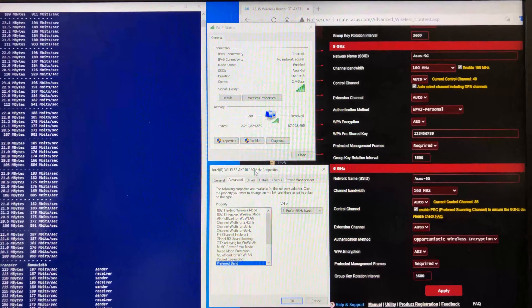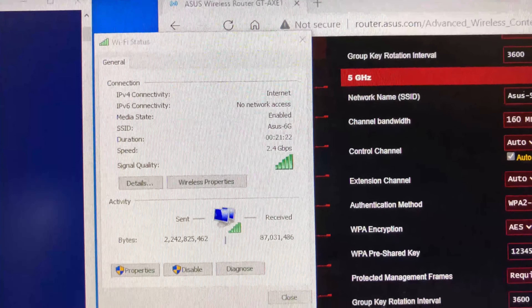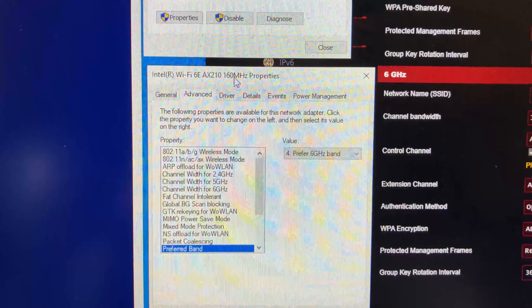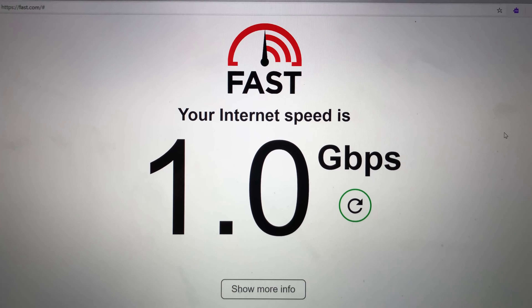As you can see on the screen, we have all three Wi-Fi bands set up separately. We will only be using the 6 GHz and 5 GHz channels for best performance results. Both bands are set to 160 MHz bandwidth, and you have the option to select your channels manually or leave them to auto. I have a 1-gig Verizon FiOS connection.